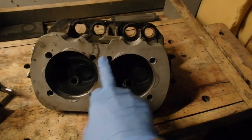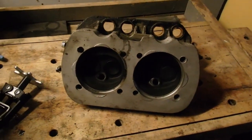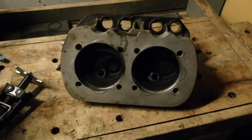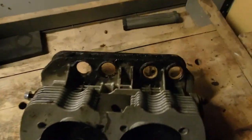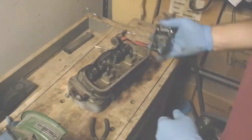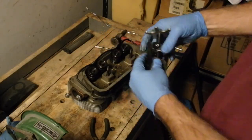At this one, there's no obvious blowout. On the other one, the valve springs are already removed. There is some blowout, so clearly I was losing a teeny bit of compression, and it also needs a clean. Can you see where my oil leak might have been? It's not the greatest tool, but it will do the job I need it to do.